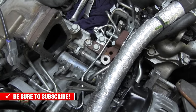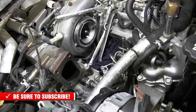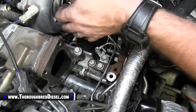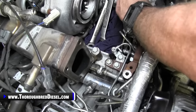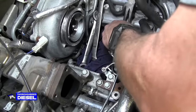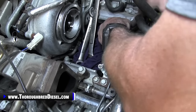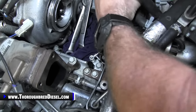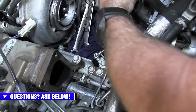So next we're going to remove the rubber return hose side. It's just a little U-shaped line here. You'll get a different one that comes with the fleece kit. So we just want to break that line loose and hopefully it will come out for us without too much work. And I'll take the clamp off of the CP4 for the other side of it. Looks like it's going to want to go the other way.